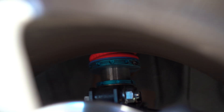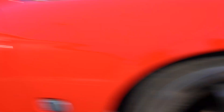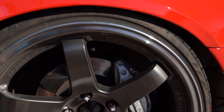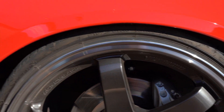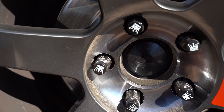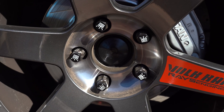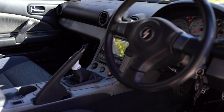The car is sitting on 326 Power coilovers — these things are amazing. It's got 12kg front spring rates and 7kg in the rear, so quite soft, but with this wheel setup the suspension works super well and it's very comfortable. Also got the 326 Power lug nuts — gotta have those crown end caps.